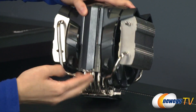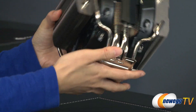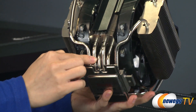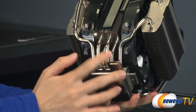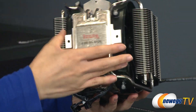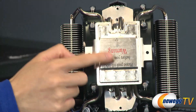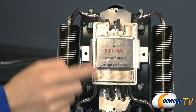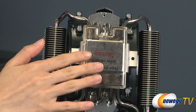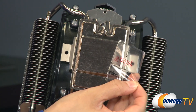Now for the heat pipes. You get eight 6mm heat pipes total. On either side, dual heat pipes run through the smaller outer stacks, and four heat pipes — or eight if each U-shaped construction is counted as a pair — run through the main center stack, providing excellent cooling. Down at the bottom, the two sides that jut out are the mounting points. The base is the horizontal vapor chamber, which essentially functions as a flat heat pipe to direct heat away from the CPU and into the eight heat pipes as fast as possible.